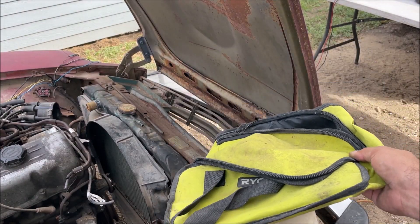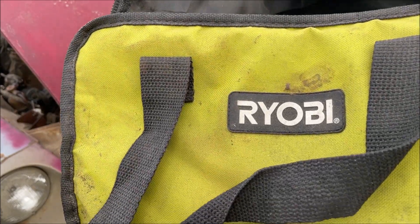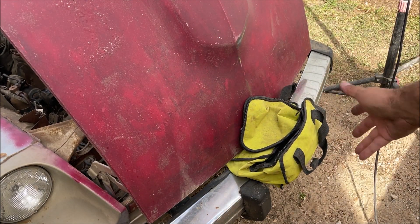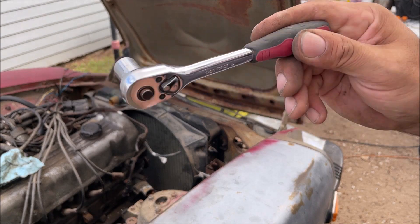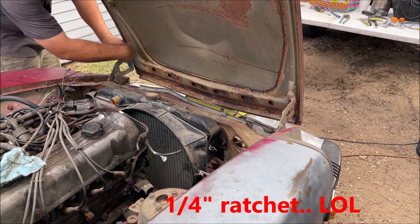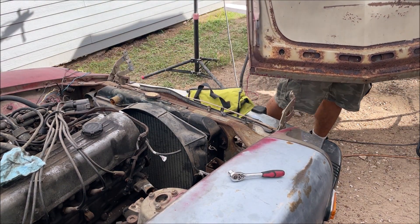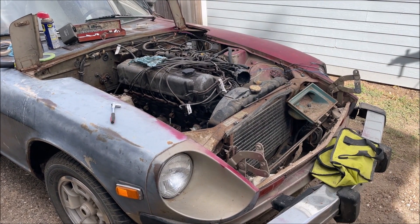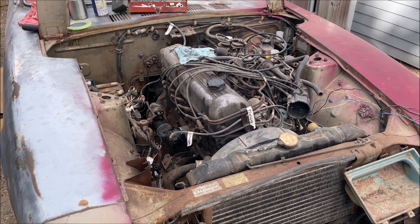The paint is already screwed up on this car, but we still don't want to scratch it worse. We're going to stick something under the front corner. We need a bag to place under the front of the hood to give us the right depth. Going to undo the bolts and set it on the bag. Hood hinge bolts are 12 millimeter. The hood is not heavy at all, but it is one of those hoods you need two people to take off or you're going to hit something for sure.